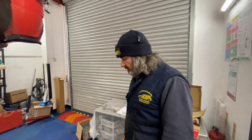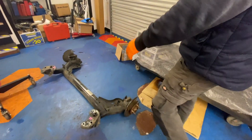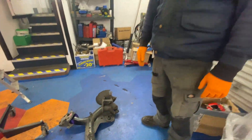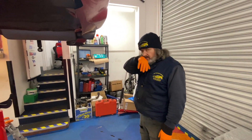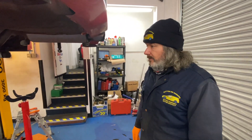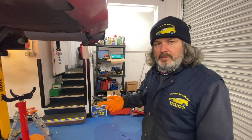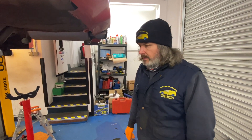Carrying on with the changes. So the rear axle - we put the polyurethane axle bushes in there, they're all done. We've got to do the fronts; we're going to have a go at that maybe tomorrow - get the front arms off the front subframe, do the anti-roll bar bushes. We're still waiting because they're either 19 or 21mm and we're still waiting for the 21s to arrive, so we can do the other bushes and get that out of the way.